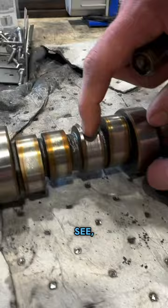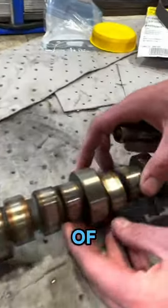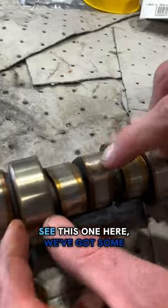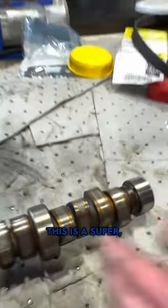It's going to take all the metal off of that lobe. See, that should look just like this one. You can also see where we were starting to wear on a couple of our other lobes — see this one here, we got some good pitting in that lobe where another lifter was starting to fail.